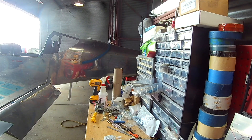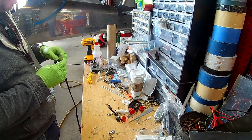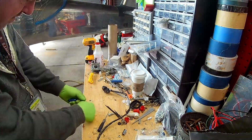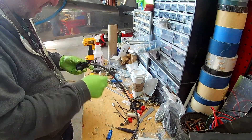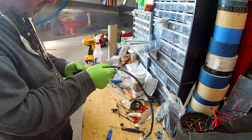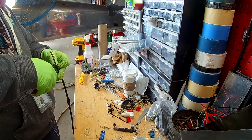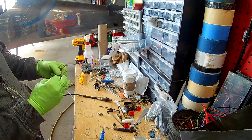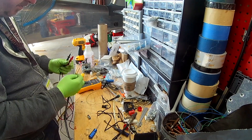So I'm going to put 12 volts across it to find out which ones are the power wires — that's easy enough. Then to test the sensor, we're going to clamp it down, get a propane torch, and heat it up. As we're heating it up, we're going to test the other wires to figure out which one's the signal. You need it to be very hot, but also to actually give a varying signal you have to use up all the O2 around it, because it normally looks at exhaust from an engine that's burning O2. So you put a big propane torch on it, burn all the O2 off around it, and you'll start getting a signal. That's in the next video, which is really cool.